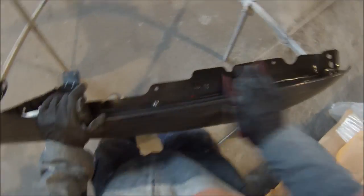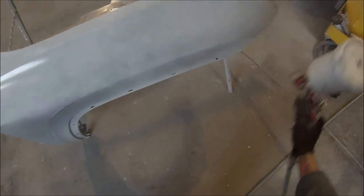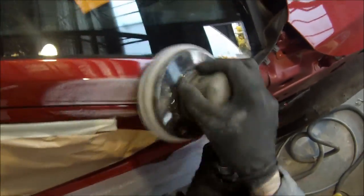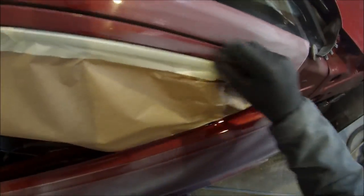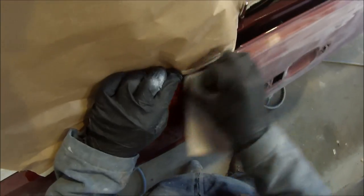First up I was getting the double sided tape or the glue off from behind where the body moulds were, because we pulled them body moulds off. Next up I'll start buzzing down this fender — sanding down the fender and then giving it a quick scotch brite around the edges. I was using 400 grit there, and next up I just decided to use a bit of 1K primer over this fender. So we just spray just a quick coat over that, and then while that's drying — it won't take too long, about 10–15 minutes — I'll start sanding the rest of the car down, which is just a bumper bar and a blend on this driver's side front door. What I'm using here is a 600 grit after giving the panel a really good clean down, just with a bit of water and a damp cloth and then drying it off.